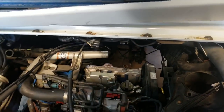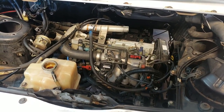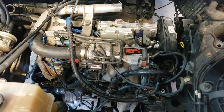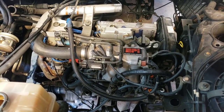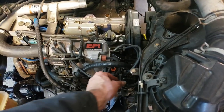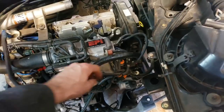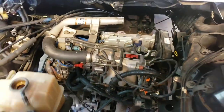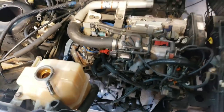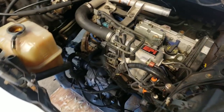Unknown to the customer who bought this car, this car has been raced, and I think quite competitively. It has a limited slip. It has all kinds of boost controller and blow-off valve modifications, most of which have been basically abandoned — disconnected and abandoned. And I think that contributed to the head gasket blowing on his cruise, probably on the caravan to Concorso. I think it blew up, which is a bummer.